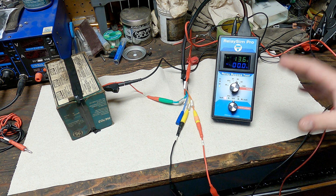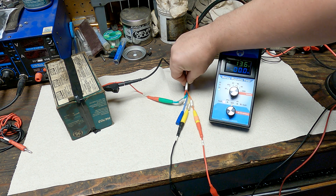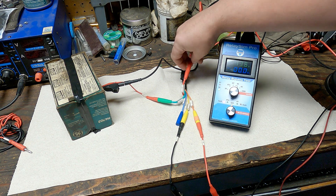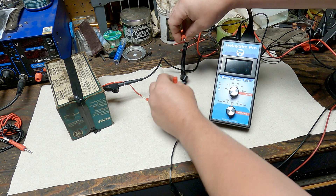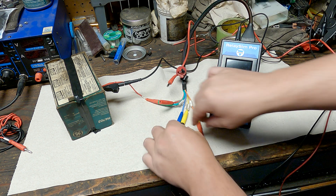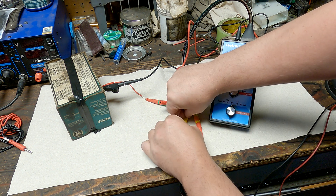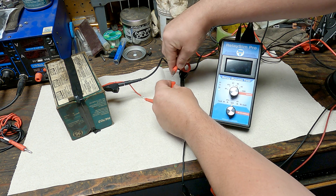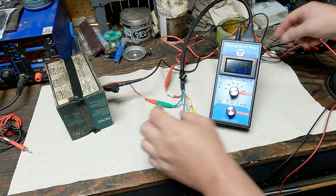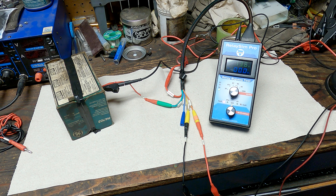I have this all set up already. The red wire coming in on pin 30 on the universal harness is the feed. If you don't have voltage on your feed, the tool will not power up — the LED will still power up, but the rest of the tool doesn't. So we're going to connect our feed, and we do have our ground hooked up to the battery ground.